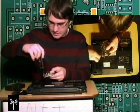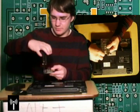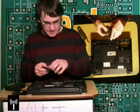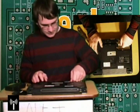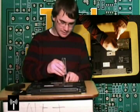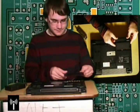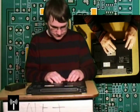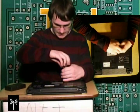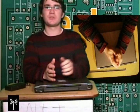It's kind of tricky, but there we go. I'm just going to pop one screw in right now because I've got to take this laptop apart for further upgrades later on, but this is just to demonstrate. You would put all four screws into the casing, then just line it up, slide it back into the computer, and stick your two screws back in. Once you do that, you want to put the casing all back together — slide it in place, tighten the screws — and there you go. Now your laptop has got the brand new hard drive in it.